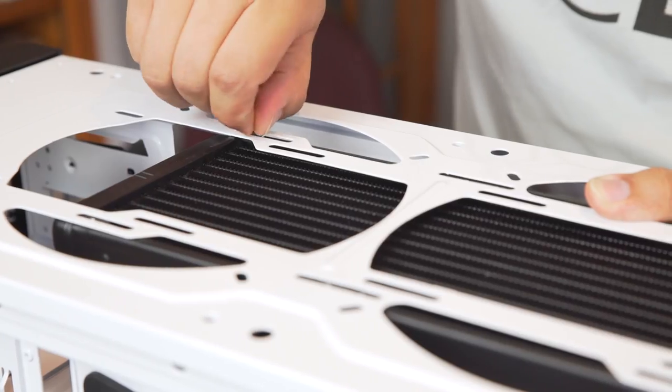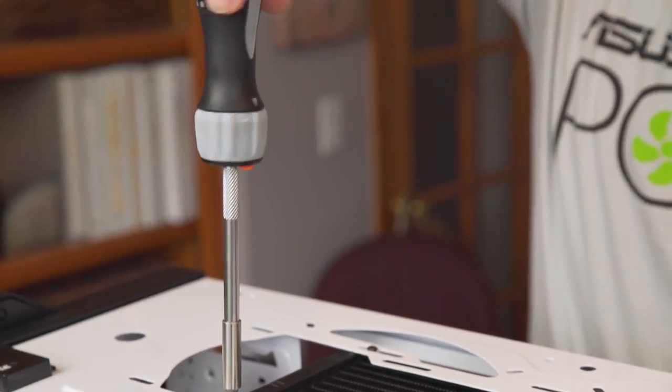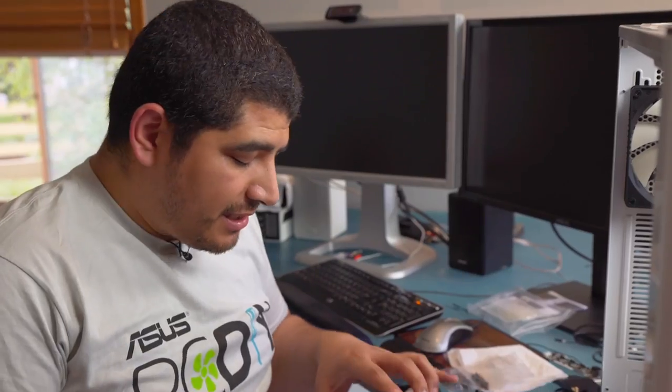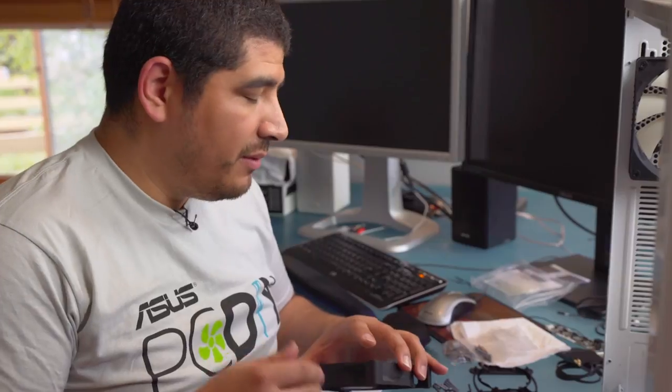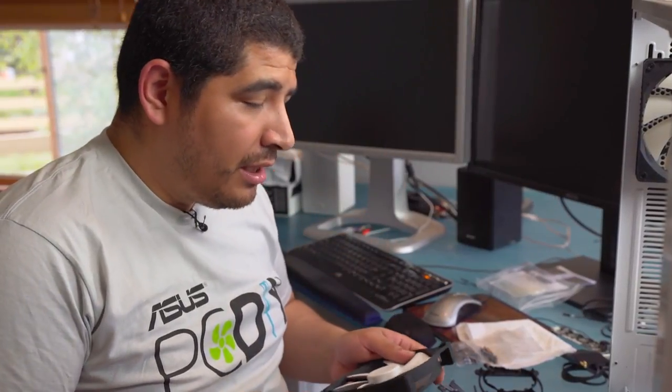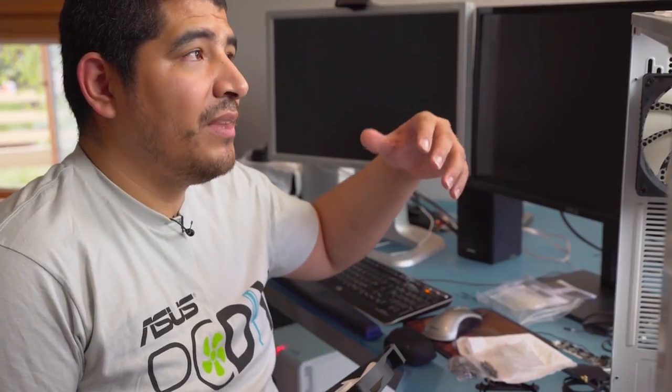The first question I asked was about graphics cards, since it seems like my old GTX 680 was never working that hard on playback. You've got a 680, which is a pretty good choice, but probably the bigger benefit might have been the 4 gig frame buffer, but that's only if you're doing really, really high bitrate video. But in many situations, there's kind of a cutoff point with the GPU. At a certain point, even if you keep getting faster and faster GPUs, because of the way a lot of these video applications are designed for acceleration, they don't generally know how to use the additional portions of the GPU to keep getting improvements.